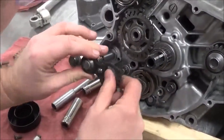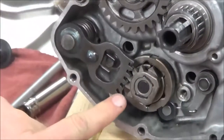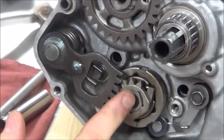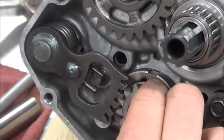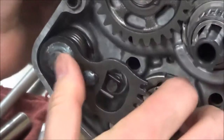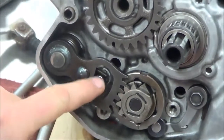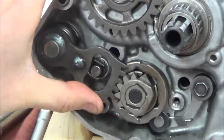You can see there is an alignment piece here, and what you want is these teeth to be in the middle. If they're not centered, when you go to upshift or downshift at some point you're not grabbing all the teeth - or you might just get one turn out of it. When fully assembled you want a real equal amount of teeth. Did you see how that spring internally went around that pin in there?